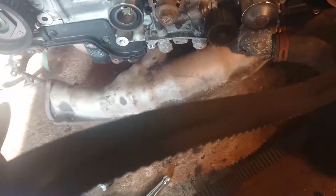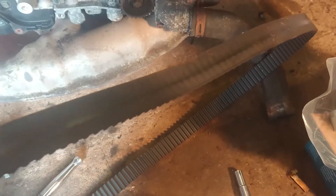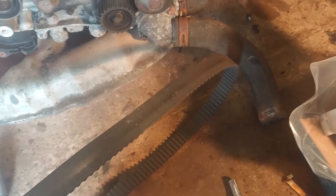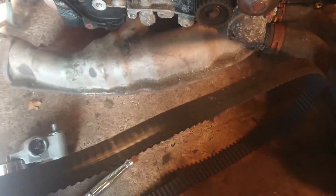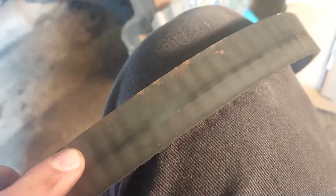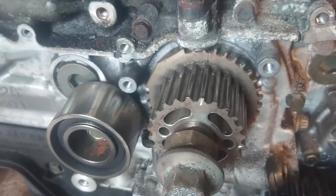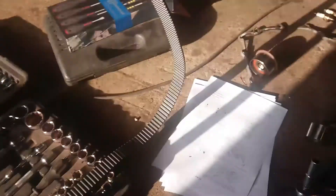I've got the belt off. When I was trying to line the timing marks up I realized there are no actual marks on this belt at all. Every YouTube video, every walkthrough, and every picture in the service manual shows timing marks on the belt that you line up with the marks on the pulleys - and this belt has absolutely none. There's also a mark running all the way down the middle of the belt where something's been rubbing. I suspect the little bracket that prevents the belt from jumping on the crank pulley has been set too close.